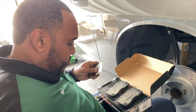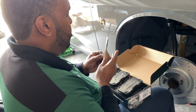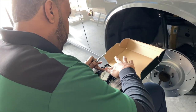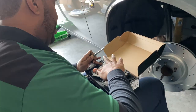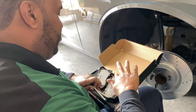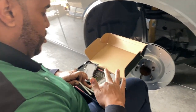Speaking of that — I was driving and I saw a state trooper with lights flashing, whizzed past me going the other direction. Guess what it was? It was a Hellcat, bro. They're not playing. As for the install — that lubrication goes where the rods go in the brake caliper, and also on the pads so they don't seize. That's where your squeak comes from — the back of the pad. If you don't do this and just put them in, they'll squeak. Brembos squeak all the time, especially after rain.